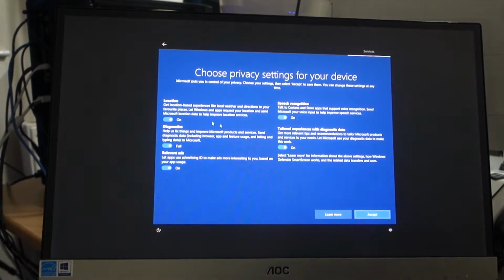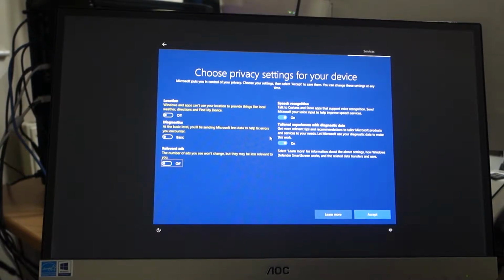But if you go back to the Windows installation process, it's very, very simple. Just a few things. What I do is I don't put a password on it, so that if I need to restart, it just logs on automatically. Just little things like that. You don't need all the ads and that kind of thing. Just try and keep it as limited as possible. You don't need a product key either. If you want to activate Windows, you can, but there's really no reason to. I've got Windows activated on my main PC, but you can continue to use it without being activated anyway. So it's kind of pointless for a mining rig.